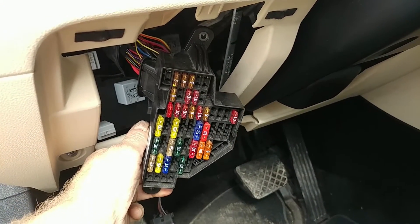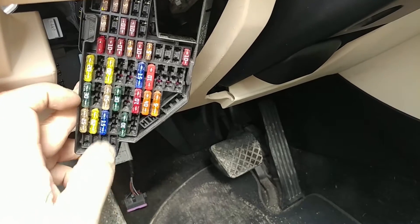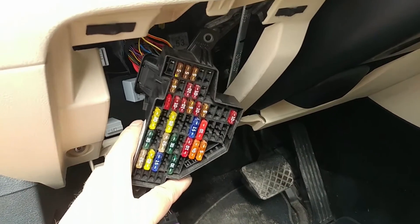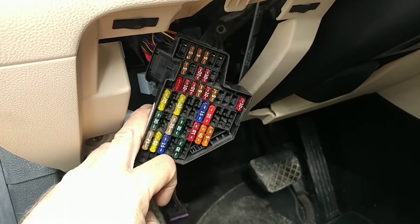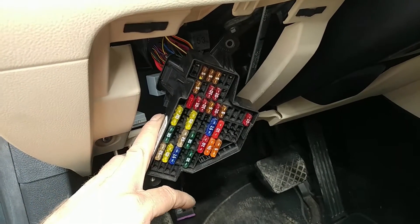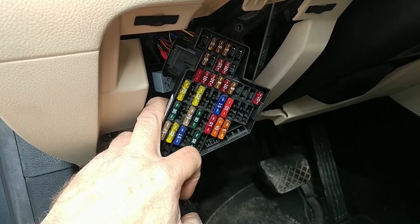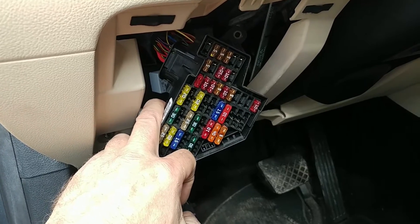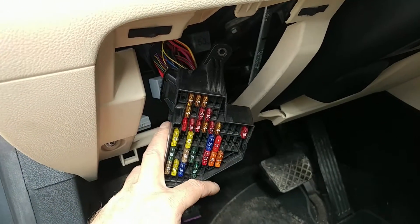So it ends up this row right here, and right down here, as well as that 30 amp fuse right there, are what's powered by this SA4 bus up front. However, that bottom 30 amp fuse was not indicated in any schematics. So it was quite troublesome — I had to actually probe at each and every fuse location to find out what was additional to what they had spec'd out, and it ended up being that 30 amp fuse right there.